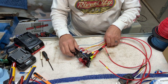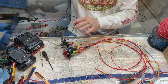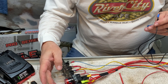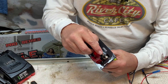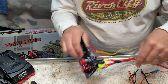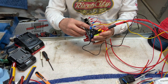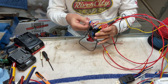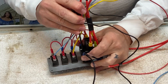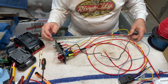Okay, so there we go. One last wire to hook up and this will be a ground — not a ground for a switch or anything, just for the two LED lights on this switch panel. There's one on the end of this switch and one inside the start switch. You'll see this terminal that sticks off the bottom of the main power switch — you're going to put that there, and then take the other side and hook it to the negative part of the LED terminal. Slip that fork terminal right in there. All it does is provide the ground for the two LEDs in the switch panel.